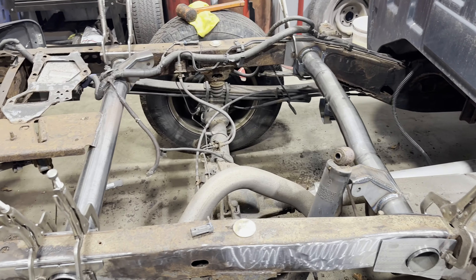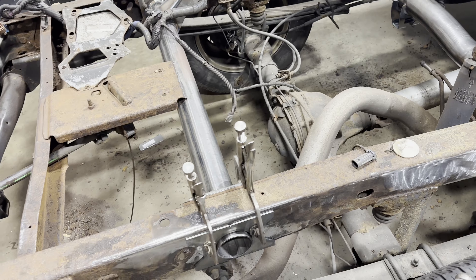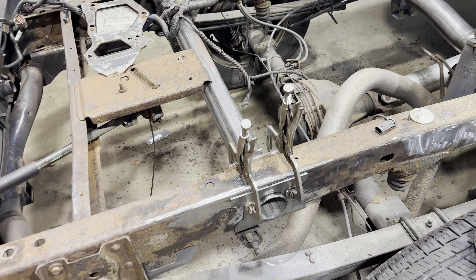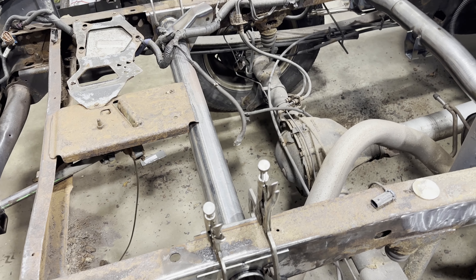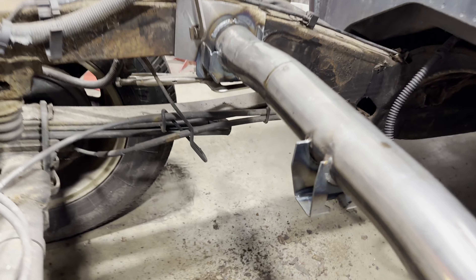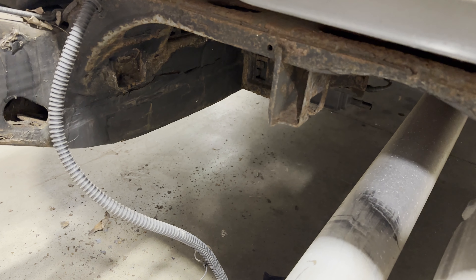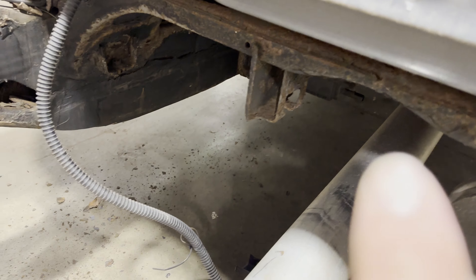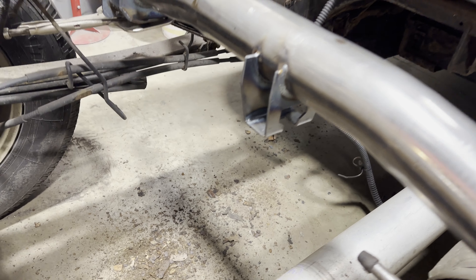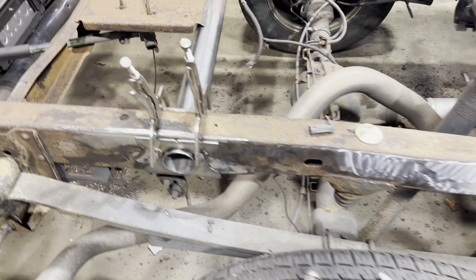Now that we have these in and clamped, we can talk a little bit about positioning. Positioning on the cross members on these Silverados is not nearly as important as it is on the Jeeps. On the Jeeps, you're relying on the alignment of your safety cap piece to determine your suspension location overall, so you've really got to be careful where you place those. On these, it's not really that big of a deal if they're off a little bit. The only thing you really need to be concerned with is that the gas tank strap mount is on the same plane as the other gas tank strap mount. You can literally just use your phone with the angle finder or the level, put it flat on the bottom of that one, and then do the same on the other one. If you're off a little bit, you can literally just grab the whole thing and rotate it before you start welding it in. So placement's not a big deal.